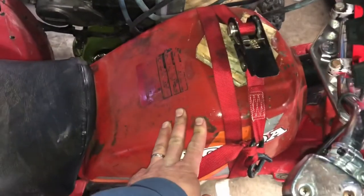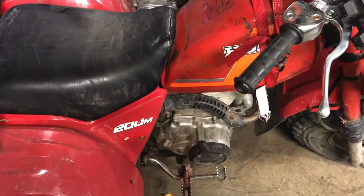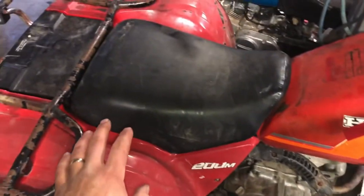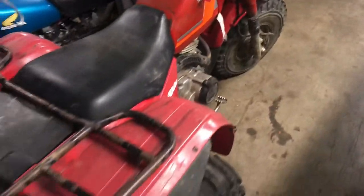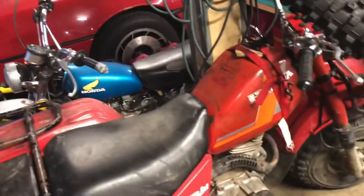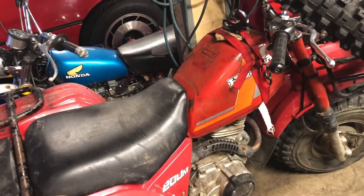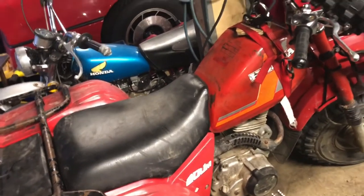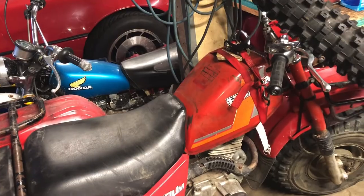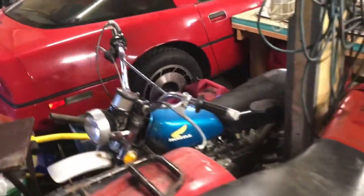The three-wheeler will get its new gas tank so it can be more rideable, and once it has that tank it is ready to rock and roll. After that, phase two is brakes front and rear. The muffler is totally rusted out, but I plan to just run this thing hopefully forever — it's a piece of history. It runs great; there is a ticky noise up in the valve train I'll need to figure out. I still need to adjust the timing chain tension — that's the only maintenance item I didn't do, because I hear those tensioners get stuck.